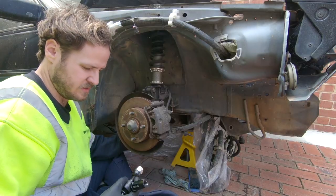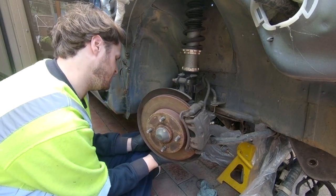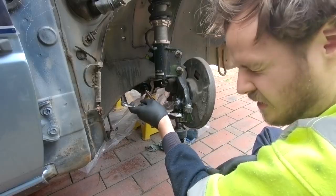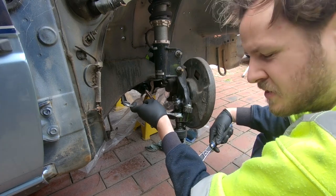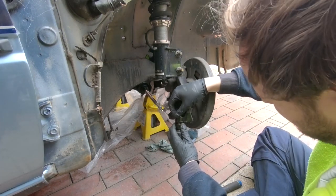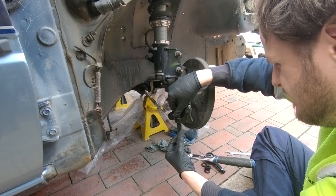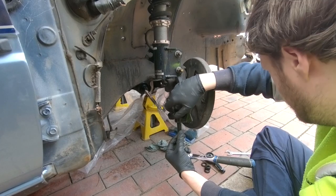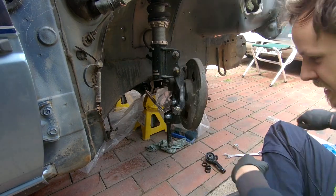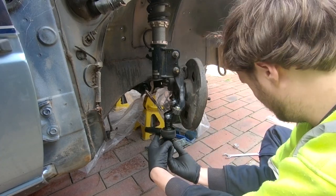They're going to stick out so far. I don't actually know what I'm going to set these as yet, and I'll probably have to redo it once I get the car and other bits and pieces back together. I think what I'm going to do is do the tie rod end side first. I didn't get any instructions with this, so I had to double check the video a couple of times on how to do it properly. And now I know how to do it properly — the way I was doing it was not properly. First things first, that on top. And now you torque it. It's 50 foot pounds. There we go, torqued to spec.